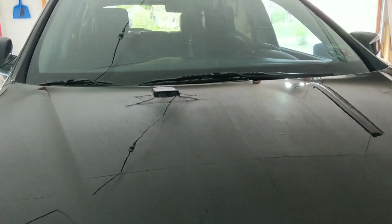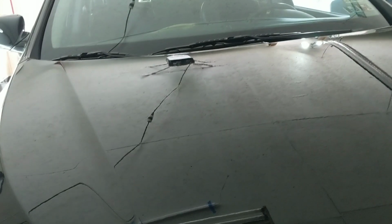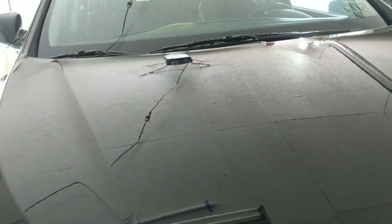Well, let me show you. I did 4 very quick passes. Orange pad, Flex 3401. Look at that. We've got a little bit of polishing oils. That's showing you that streaking, and we're going to be removing that. Take a look at that. That is near defect free. So I'm going to put you into my tripod, and I want to show you how quickly I am moving the polisher to get those kind of results on hard Santa Fe paint that is pretty severely scratched.